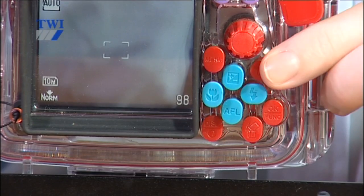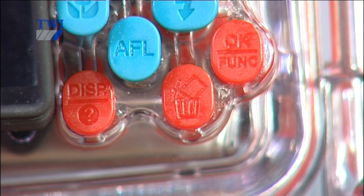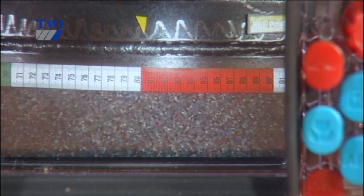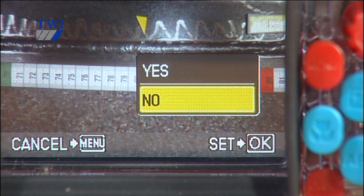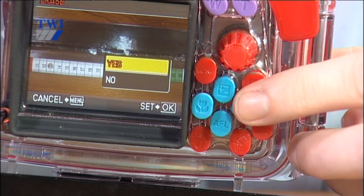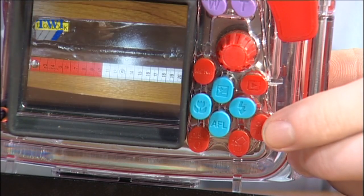If we've taken a picture, zoomed in, and found that it's out of focus, what we want to do is delete that photograph. When looking at the last picture taken, press this trash can button — a picture of a bin — which is a red button at the bottom half of the camera. Depress that once and that gives us the option to erase; it doesn't delete the photograph immediately. Once we've got the option up, we use the turquoise buttons in the centre as a navigation aid. Press the upper turquoise button to highlight Yes in yellow, then press the OK red button and that deletes the picture. We'll then press the play button and go back to retake that picture.